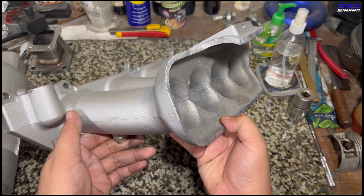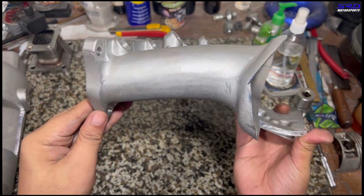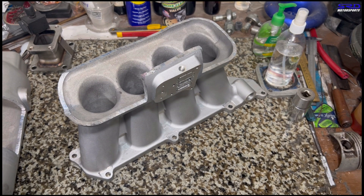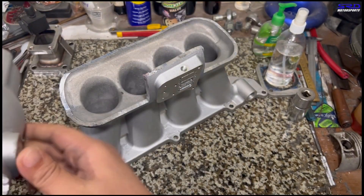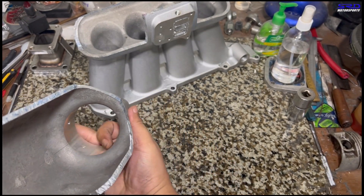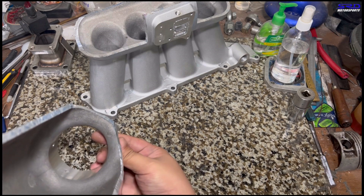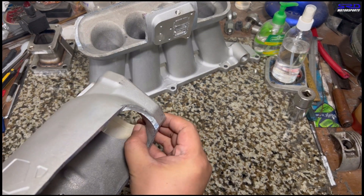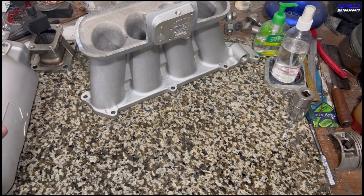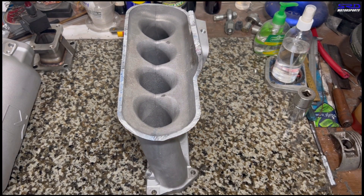You can see the taper of the runner — it's pretty good. This is like a slightly longer, or one inch longer runner than a B-series Victor X from Edelbrock, which is pretty good. But the casting is a whole level better than the Victor X, no doubt. Even on the throttle side, after the flow passes the throttle it expands really nicely and is quite uniform — that's like a reverse velocity stack. This is excellent and it's going to be so fun to port. We're going to bring this to the porting bench.